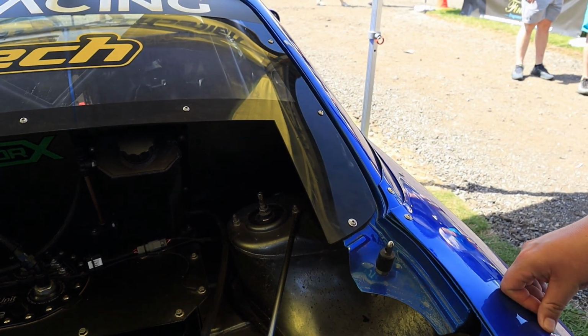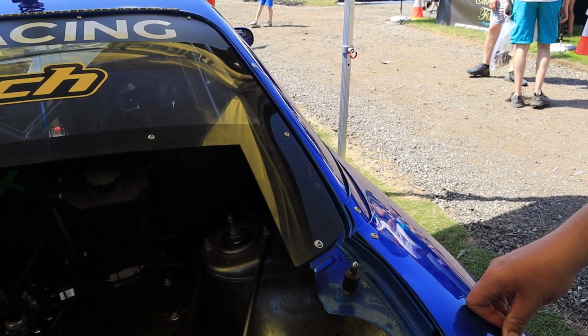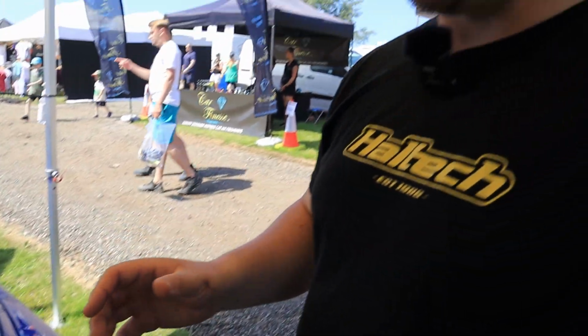But if you're hard sprung but with quite soft damping, does it not make quite a bouncy ride? A little bit, yes. But we're after the squat, to make the car squat down and go. It depends on the circuits as well. Like Brands, obviously, it's so soft and nice. We can change. Yeah, it's almost like it requires you to be smooth on the throttle, because if you keep bouncing up and down on the throttle, the back of the car will bounce up and down. But then I guess if you flip that, it also means that you can move the weight around by using the throttle, right? Exactly.